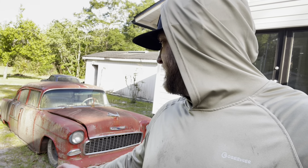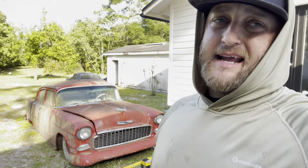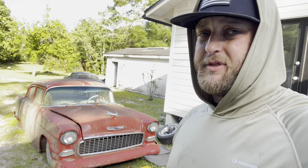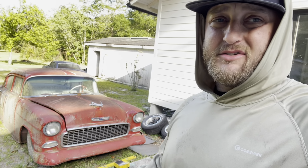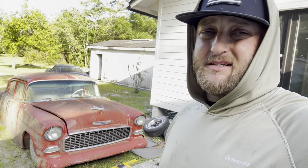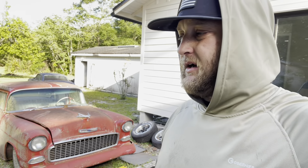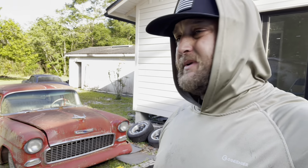Anyhow, last part of the video, first day, I got it running and I drove it back here. Still running on a gas can, with a hose in it that's underneath the hood, and still has no brakes. Starter is still messed up. Starter solenoid, maybe. It's what one of the commenters said, so I ordered one of those. It should be here tomorrow.